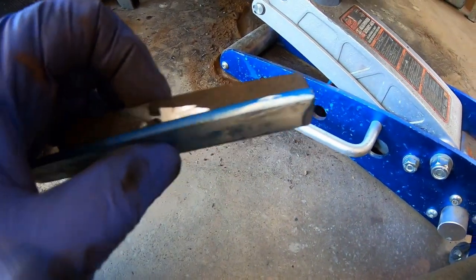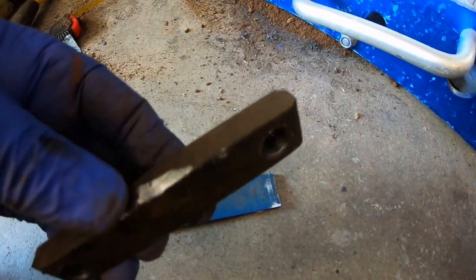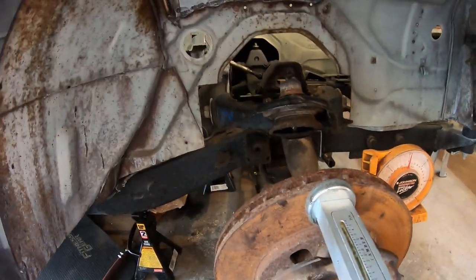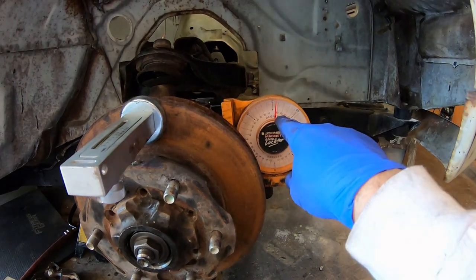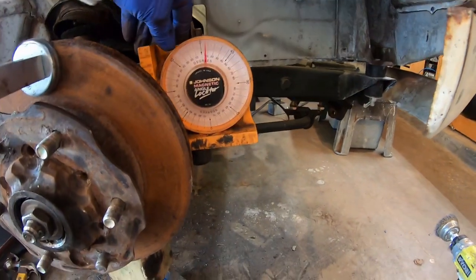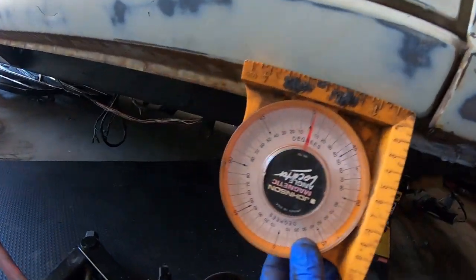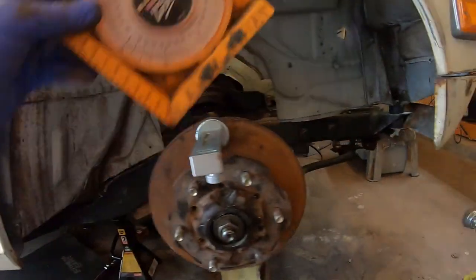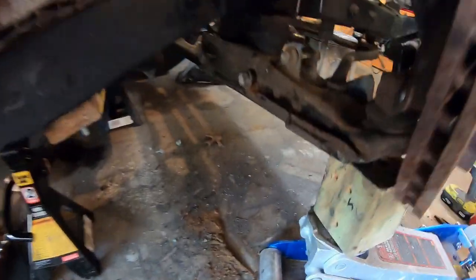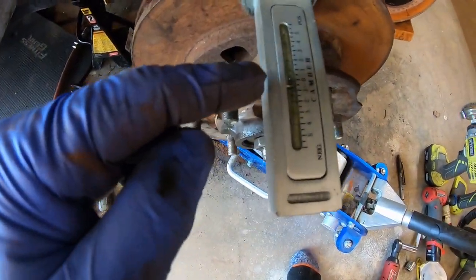Here are the factory dimensions — the outside frame was probably an eighth inch or thinner. I've got about five degrees of caster because it says about seven, but the truck is lifted about two degrees, so that's about five. That's good. I've got it based on the bump stop where I want it to be lowered, and I've got zero degrees of camber.